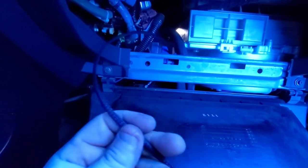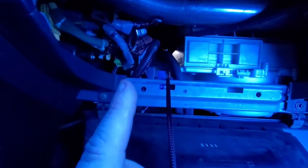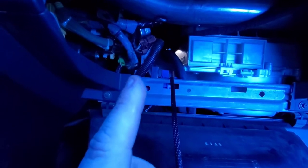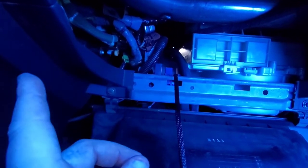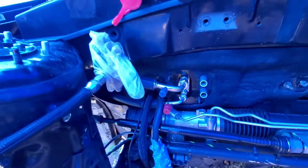Once you get this wiring hooked up, you can mount the ECU — you're not going to have to come back and do anything on the ECU side. Everything else will be done over by the flex fuel sensor. I'll go ahead and show you where to get your power source and where to ground. I got the wire fed through — it's right here and I got a lot of extra, so I'll trim whatever I need.